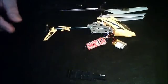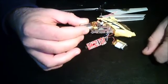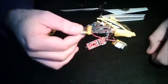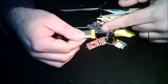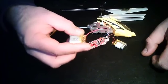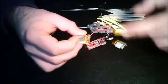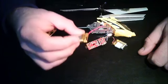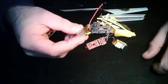So now the soldering iron is hot enough. Now here's a quick tip on these kinds of procedures. You know that LiPo batteries are very touchy when regarding short circuits. So when shipped, usually these kinds of batteries come protected like here, and it's insulated. The negative wire is insulated against any short circuit during transportation or whatever. So you need to be very careful with this because they don't really like short circuiting. If you do, it's bye-bye cell, and this is on a one cell battery. It's dead if you short circuit it.